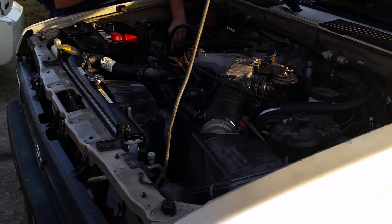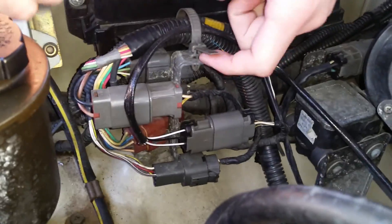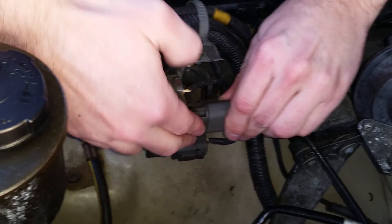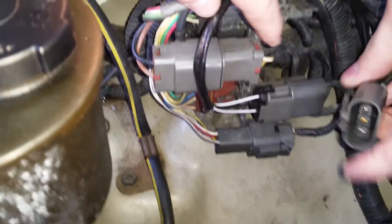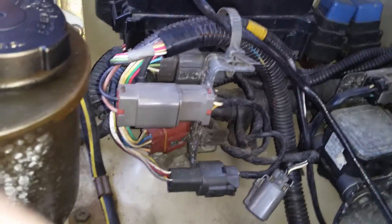Now we're going to run over here and show you where the O2 sensor is. It's got one of those little funky clips on it up on top — a wire harness thing right there. Behind the back right here is where you actually release it. You've got to push this tab in and pull it. Push the tab in, wiggle it, and pull it. This actually sits on a metal tower that goes all the way down and bolts onto the frame of the car, but you can get the connector off just by wiggling it and pulling it forward or towards the rear of the car.